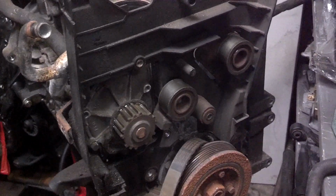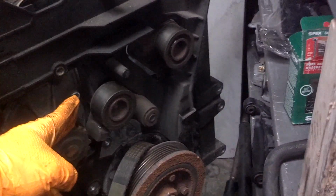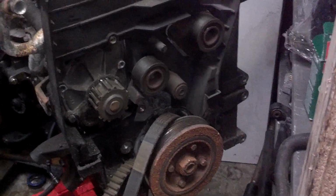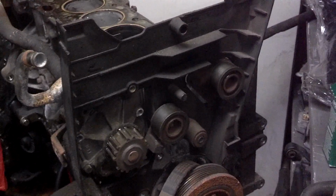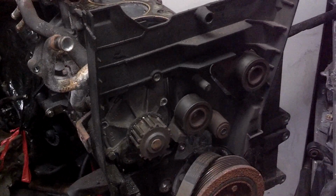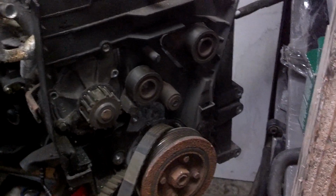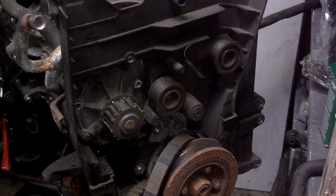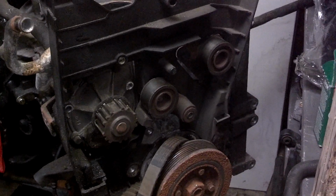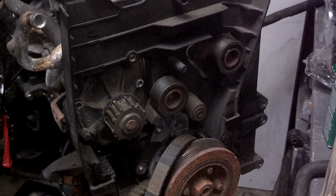The schedule on my car is 70,000 miles. The schedule on most cars is 100,000 miles. If you don't get parts that are quality enough to last 10 years or that 100,000 miles, you are going to be sadly sitting on the side of the road with a busted timing belt situation. I have talked to numerous people that got a full timing belt kit off of eBay for $70. They're excited, they're happy, until 2 years into it, and 30,000 miles later, one of these parts break and the timing is thrown, and you're sitting there with a blown motor. It just doesn't make any sense. Spend the $200 or $300 on OEM dealer parts or the good quality equivalent. That way you're not stuck with a bad busted timing belt.